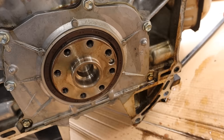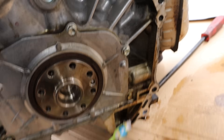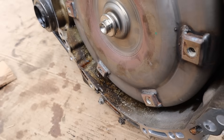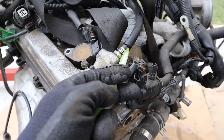I never drove this car. This thing had a pretty active rear main seal leak, but it actually wasn't leaking from the seal itself — it was leaking from the gasket that goes around it, and you can see that on the transmission bell housing side. It was actually leaking under the vehicle. I'm surprised I didn't break that many things taking this apart. There are brittle vacuum EVAP hoses here, an aftermarket-looking PCV hose, and of course the notorious coil pack tabs.